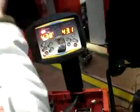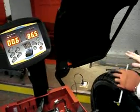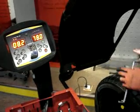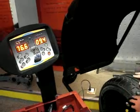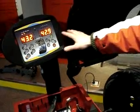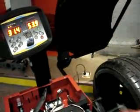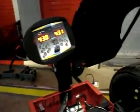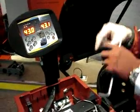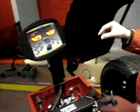So now you see, after I plug back the pickup A and B, they are both working. When I push the wheel, both two sides can fluctuate now. When I don't touch them, the value stays like this, but when I push the wheel, both sides fluctuate. Just now, the plug was plugged off, or the signal was not continuous, or maybe the plug was loose and not connecting firmly.